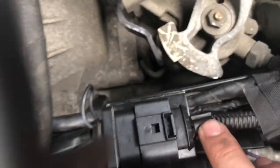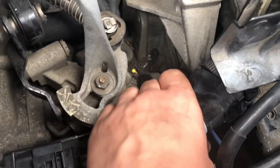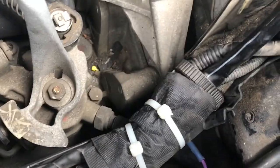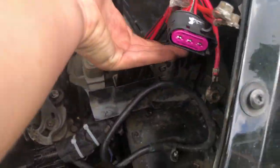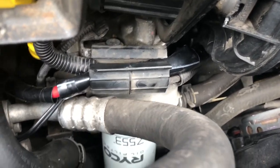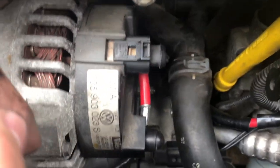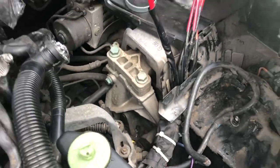It's all through the clips now. I've put the alternator cable back in, put the harness around here, zip-tied it, and made sure it's all running smoothly — it's on par with all the other cables. I've made sure it's going underneath where it should, through this clip, and both cables are connected. Now I'll put the battery plate back in.